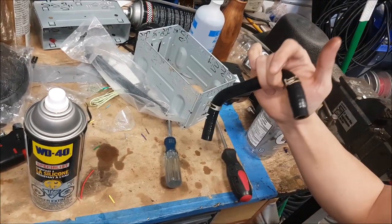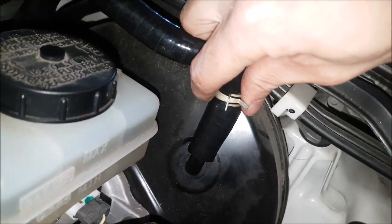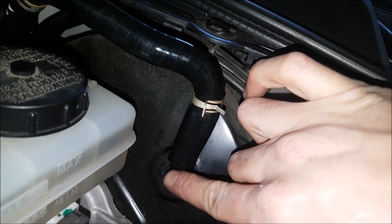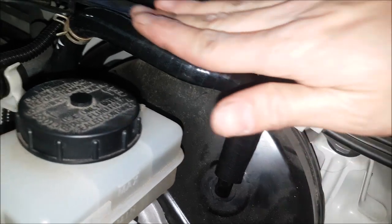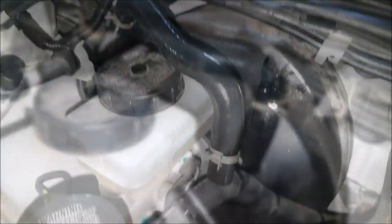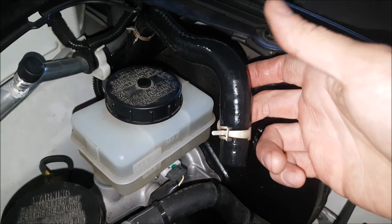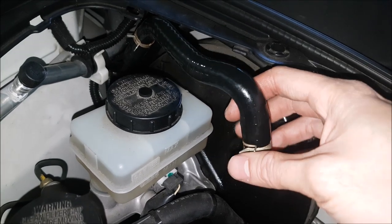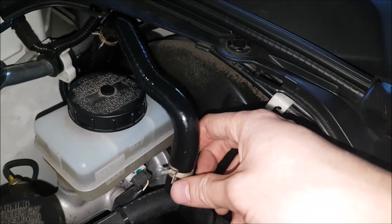You just want to go far enough in that we can put the brake booster back on and then you have that bulge in there, but the check valve is going to work. Same process like the other video — we have a little silicone lube, we're able to shove it in there. You might have to push it a little bit more, and then the metal tube will hopefully push the check valve a little further up. You want to make sure that you have clearance for your cover. After you put the check valve in, this hose diameter might be quite big, so if you want to keep using these self-tension clamps you'll have to remove it, pass it over here, take it off initially, and then put it on after.